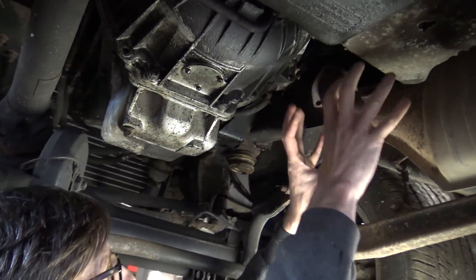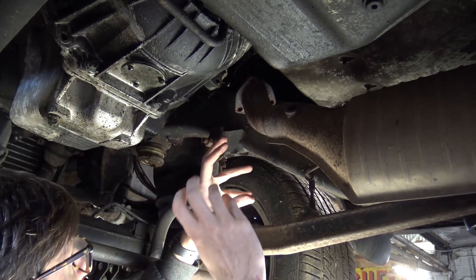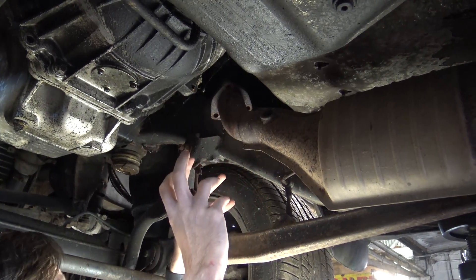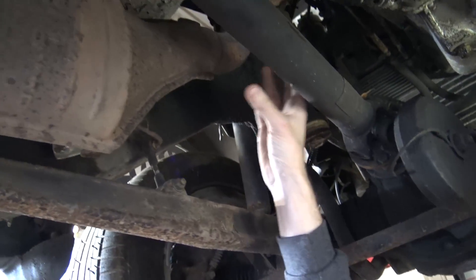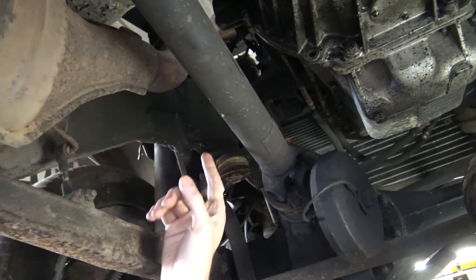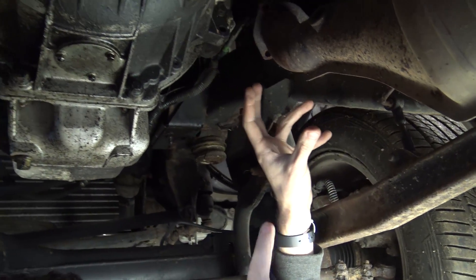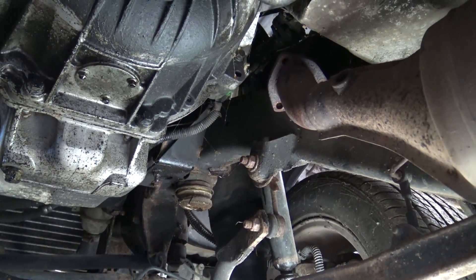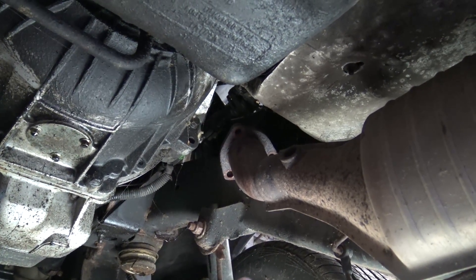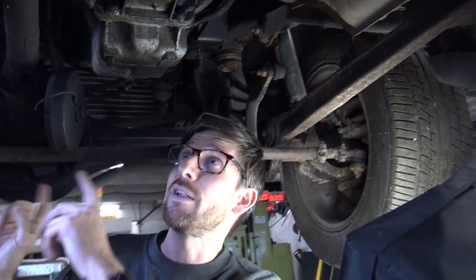So the possibility of mounting a turbo here — there is a reasonable amount of space here. I do off-road my P38 though, and I don't really want to be dragging actuators and things through the mud. However, technically I've got the Discovery for off-roading and the P38 just for green laning and towing and things. So yeah, I could mount it here. There is quite a bit of space this side, but obviously there is less because we've got a prop shaft, so you wouldn't be able to mount it there. And then you get into a very unsymmetrical look under the bonnet, which I don't like. The biggest thing here though is it's lower than the sump, which I have seen through a YouTube channel that we follow — Turbo Yoda — where Al did a sump on the actual turbo and then a scavenge pump to pump the oil back in. I don't particularly want to go down that route again because I can't mount them both down here. So I'm happy with mounting them both up this side of the engine.